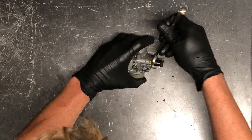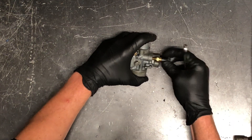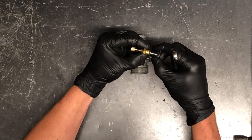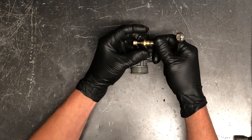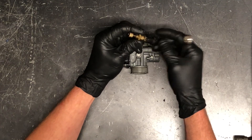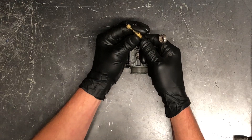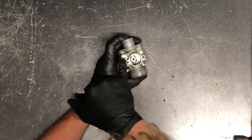Take a wrench — it's a brass fitting — just go ahead and unscrew that. This is your choke here. The way you operate it: pull it up and do a little bit of a turn to hold it in the choke position. You want to make sure that that cap springs back down when you release it, make sure that plunger doesn't have any debris, and also look in that port to make sure it's all clean.